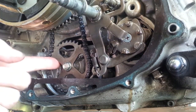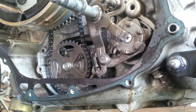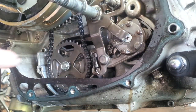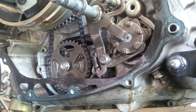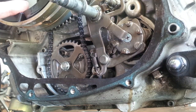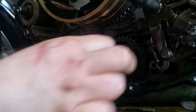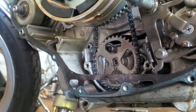As you can see, we have a sprocket. The chain is fairly loose — that is fine, that is how it should be. Start unscrewing it suddenly, because if you just apply constant torque gently so it's not jerking, you're going to turn the flywheel with the chain, and that's not really what you want. All you need is a ten millimetre socket for this, and the sprocket is out.